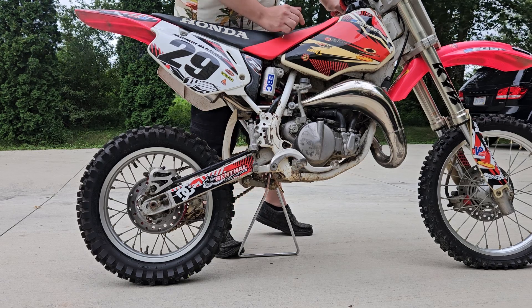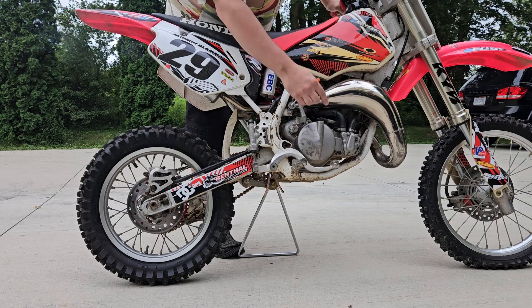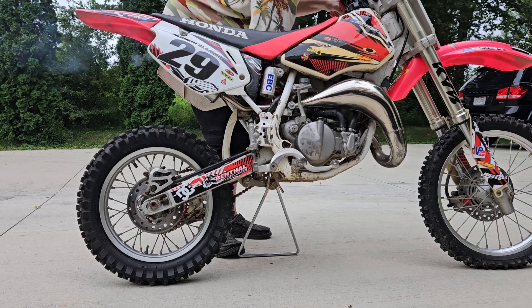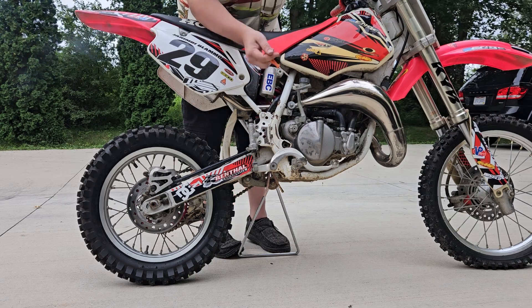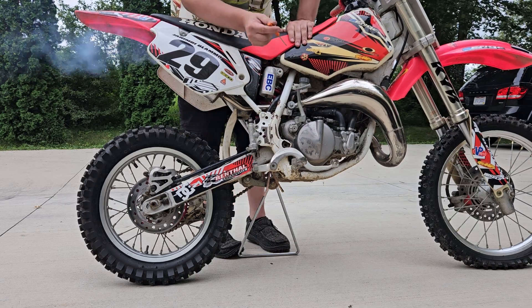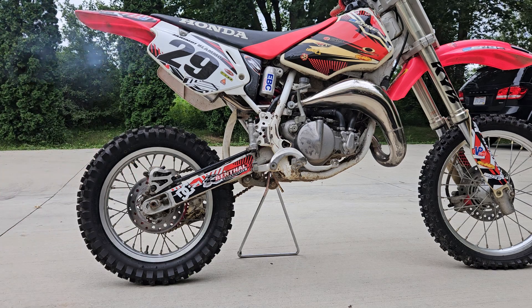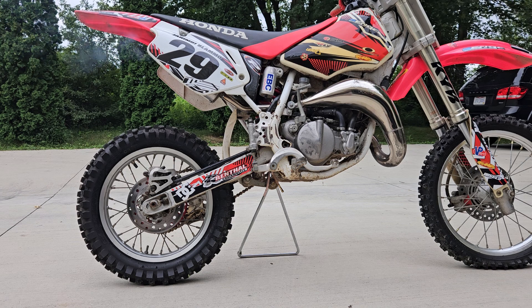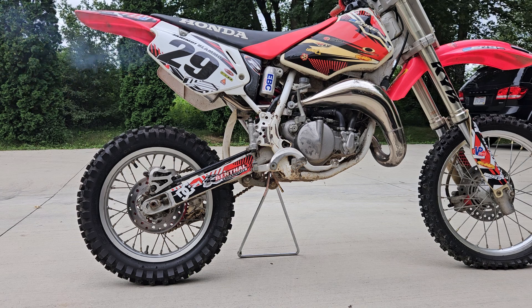See how it calms down. I feel like maybe there's a vacuum leak somewhere. So you see it slowed down when I let the clutch out a little bit, and all you do is rev it and it comes back up. So I'm thinking a vacuum leak but I've never been able to trace it down.